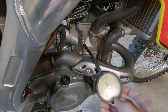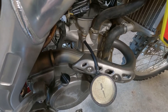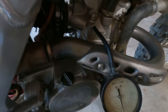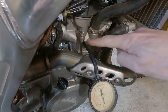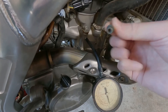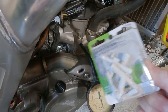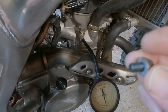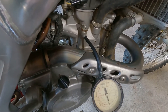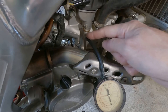All I used is some little tee fittings and tapped it with an M6 1.0 pitch thread. There's a little allen bolt you take off right here — this is one of the oil journals. You take that little allen out and find one of these little fittings that's a close size to that bolt, then tap it with the M6 1.0 pitch threads and thread it in here.